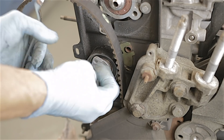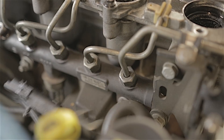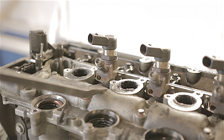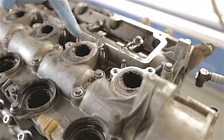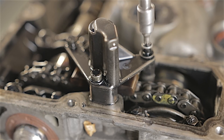Let's start getting this engine stripped off. This tensioner can come off. There's a little plastic bracket here which goes between the head and the engine block which needs to come off. I'm going to remove all these injector pipes. These injectors are held down by 7mm allen key bolts - or should I say 7mm allen key nuts. Generally speaking, with a bar and a bit of leverage you can whack these injectors out. This whole top cover has to be removed to get to the head bolts, and all these studs that held the injectors down need to come out - they're little E6 Torx bits.